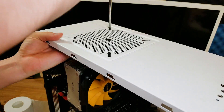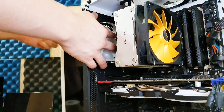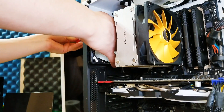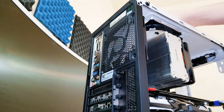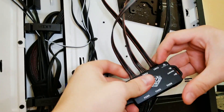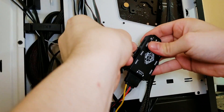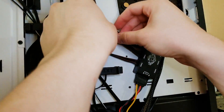The installation process is very simple — all you need is a screwdriver. These are 120 millimeter fans so they should be compatible with most cases, and they come with the necessary screws. All you have to do is screw them in. The controller gets powered with the included Molex to SATA cable — just plug it into another Molex cable and plug the SATA end into the controller. Then plug in the fans to the controller, manage the cables somehow, and power on. It's not hard at all.